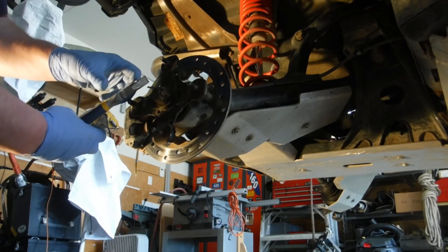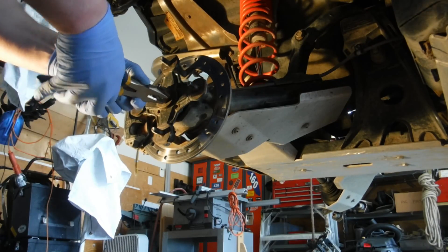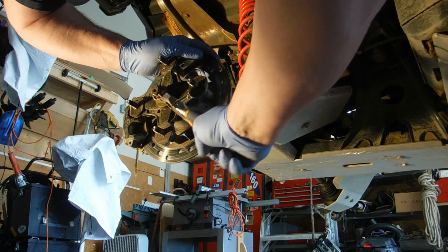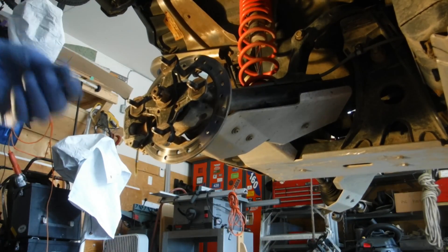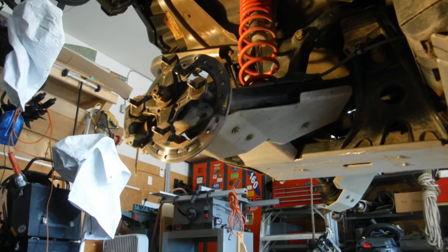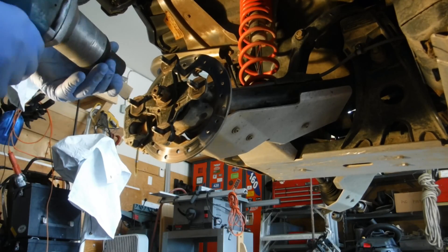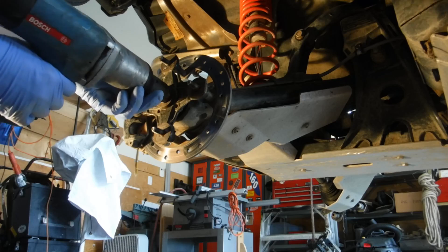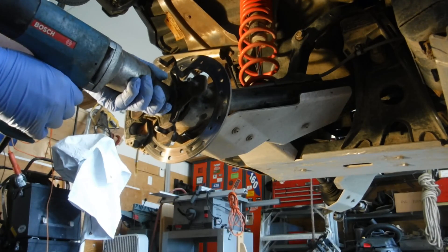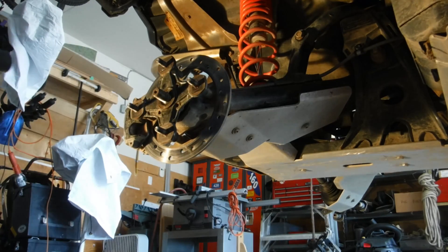I'll go through the whole process whether I'm doing it right or not — I'm not a mechanic, as I've mentioned many times, but that's how I can take it apart. You've got your cotter pin, you've got your main nut. All I have is inch and a sixteenth and it fits pretty snug. Nothing's on it at 151 foot pounds.